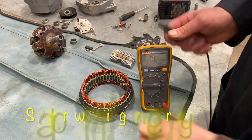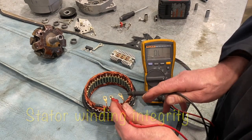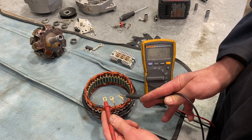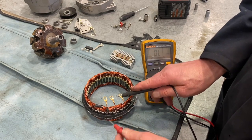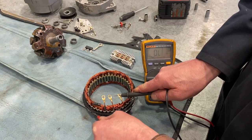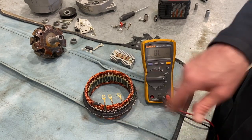One last test you want to do when checking an alternator is to check the condition of the stator. We should see continuity between each terminal, and since this is a fairly coarse winding, you're going to have a fairly low resistance value through there. All the combinations are good. You should also see out of limit when you go to the central part of the stator itself — you want to scratch the paint off when you do that. All these are showing out of limit, which is what we want because it's supposed to be insulated. All those tests are fine.